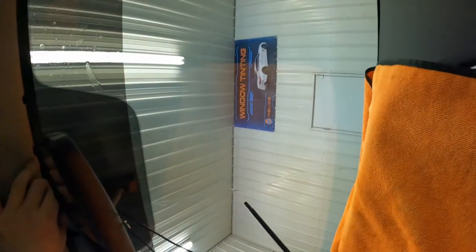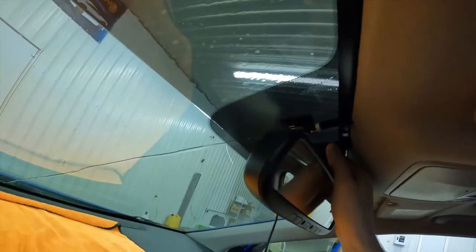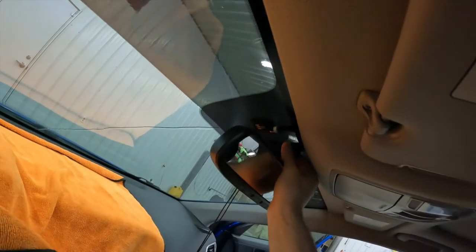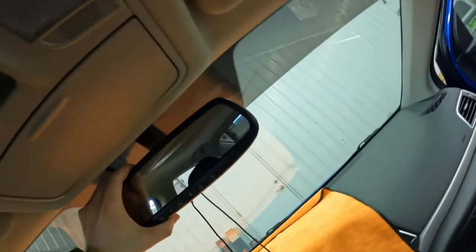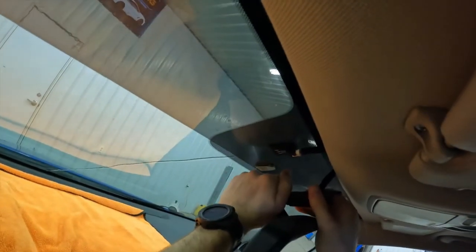You don't have to take the Torx screw all the way out — you're literally just going to loosen it a couple of notches. This little guy needs to slide down and then come out. We slide it down so we can slide our mirror assembly out. There's a little electrical connector — just push down on the little tab, it's kind of like a GM style connector.